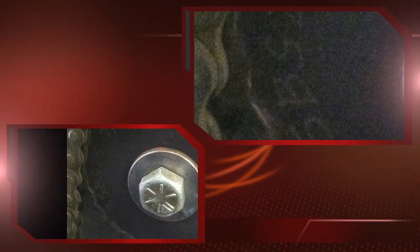The first number in the sequence is 35. This is the chain size that we have on this particular vehicle. The middle set of initials, B and S, stand for bored steel — the composition of the material the sprocket is made out of. The 25 indicates the number of teeth on the sprocket; if you count around the outside of the sprocket, you can count 25 teeth.